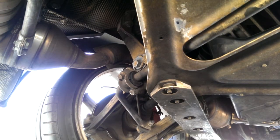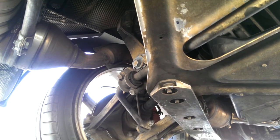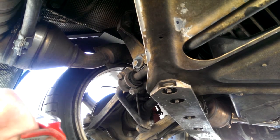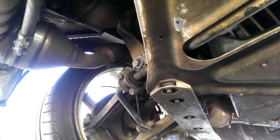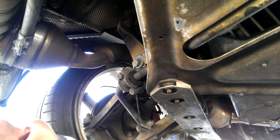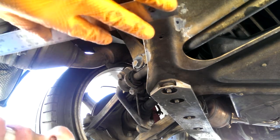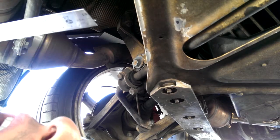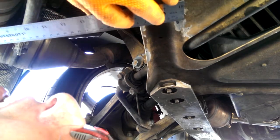Right now what I'm doing is laying out where to drill my holes for the remote mount filter. Some of you may be asking, why don't you put it in the trunk like the kit's meant to be? I just don't like the idea of the oil filter being in the cabin with me. Worst case scenario, the car rolls or something — I'd rather all of the hot oil be outside the cabin.